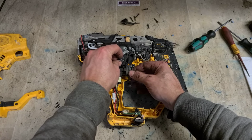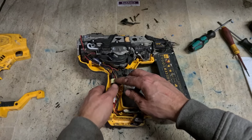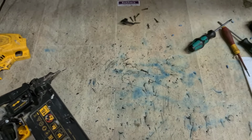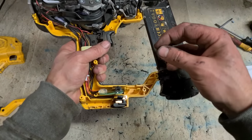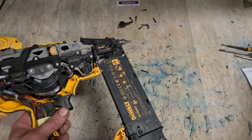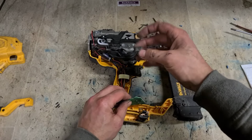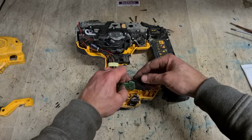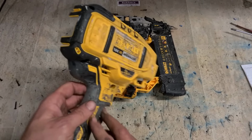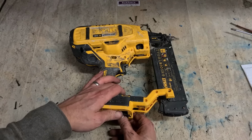This here into the top of your switch for your lock. Push them in together. Make sure your wires aren't going to catch in any of the screw holes here when you put it together again. And then don't lose the little leaf springs. Little springs just drop into here. Only seems to be one on this one. Slide switch then, hook it onto your switch itself first, and drop the two in together. That should be her. Stick your cover on, you should be good to go.